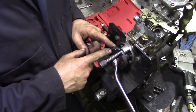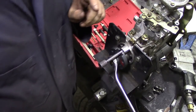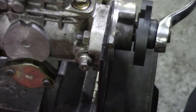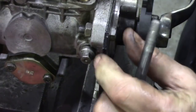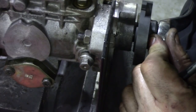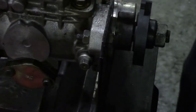Let me bring this around and show you. I'll take the pin out, turn this back - the gauge is actually on zero, believe me - turn it round until the pin will just drop in. Exactly the same place. So we need to take this off and turn it till the gauge is on 1.6 - it's way, way out. So how do we make sure that's in its right place? We're going to take the pin out, turn the pump back to zero, then turn it to 1.6. There - one... six - and this is the clever part about this pin. Tighten this bolt up and that will show the gauge here is spot on 1.6.